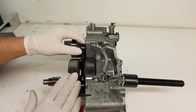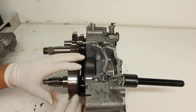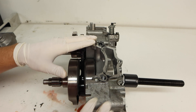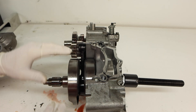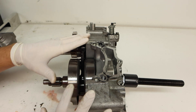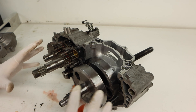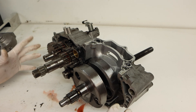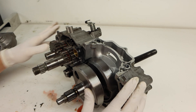The crankshaft is now all the way pulled into the left side case. It's not in its final position though — we're going to have to tweak it once we get the other case installed, and then we can set our crankshaft-to-crankcase clearance with a feeler gauge. But for now the next step is to get this case all ready to go together, which includes installing all of our dowel pins, installing all of our seals, and making sure our sealing surface is ready.